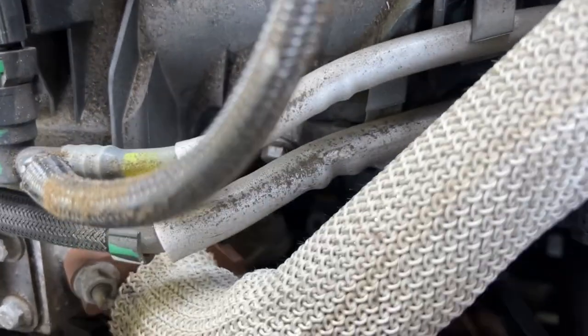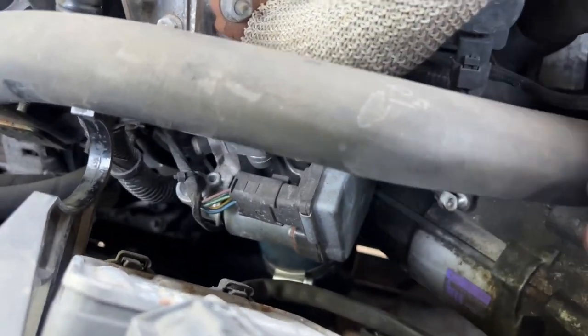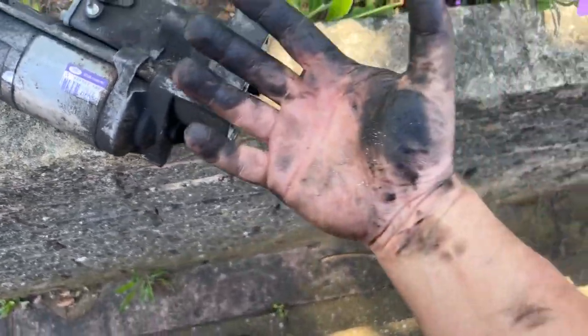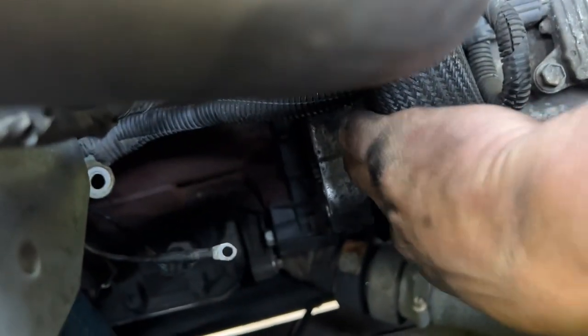It's not the lightest of things. I was chasing it around the pipes a bit - if it's not coming out easily, it's because one of your wires fell back onto the terminal. There you go - that's the starter motor out. Taking my gloves off because you don't tend to wear them when doing this type of stuff, but it didn't take me that long. So now I can see - that's where it's come from, that's what was causing the issue. This had fallen back onto the little catch, so that's all it was.